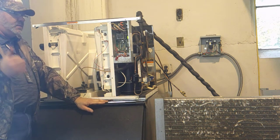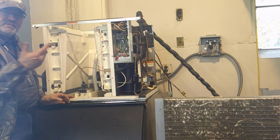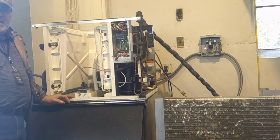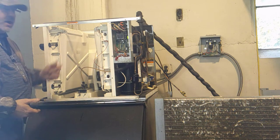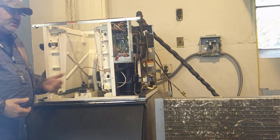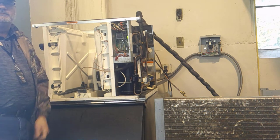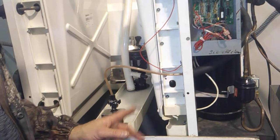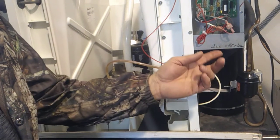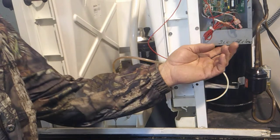So let's start off — we're going to turn the machine on. We're going to watch the reservoir empty of water. It's going to flush that reservoir out for about 30 seconds. Then it will fill up with fresh water and bring on our water pump. We're going to flip the control switch to ice and watch the reservoir empty to get any contaminants that may be in the bottom of that reservoir.